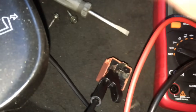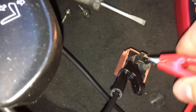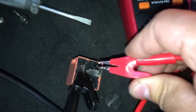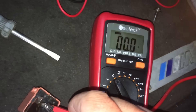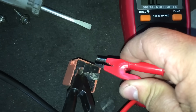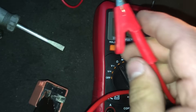I'm going to attach the multimeter to 87 first — set it to resistance. Right now the resistance shows nothing on 87. If I attach to 87a it becomes zero, confirming it is connected to 87a. If I disconnect and connect to 87 the reading doesn't change, so right now the circuit is connected to 87a.